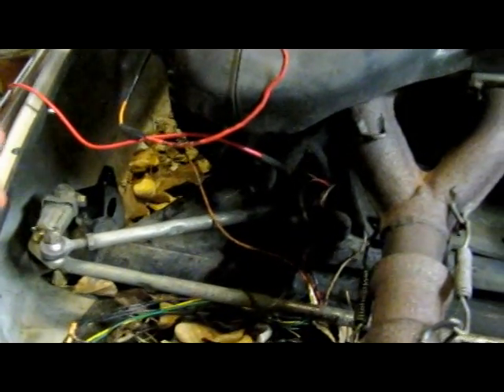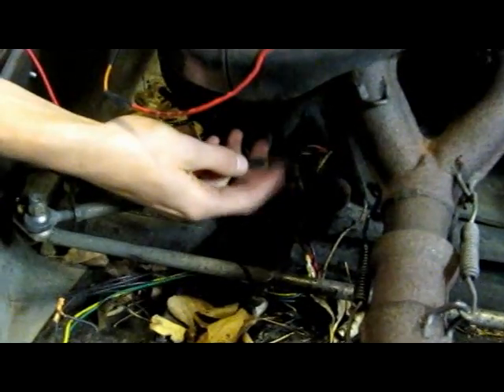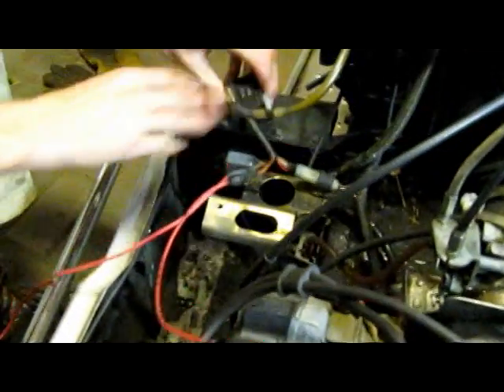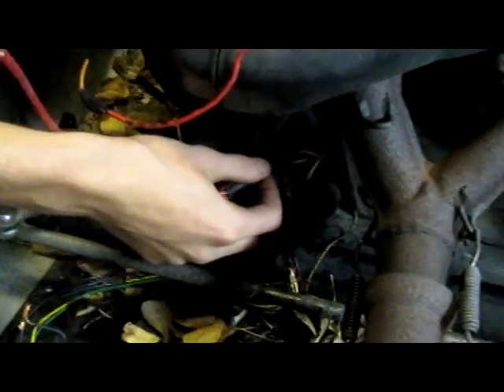So all we need is power coming from the magneto, power coming from CDI, ground the coil — sparks. We've determined that our charge wire coming out of our magneto is the brown wire, and also that our CDI is stock, so we connect our brown wire directly to the brown wire coming out of the magneto.